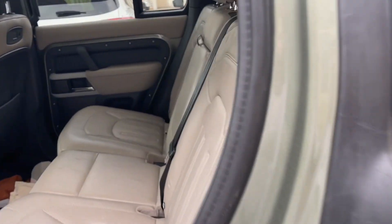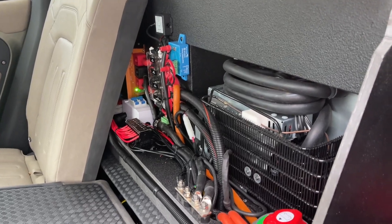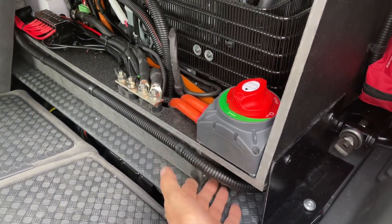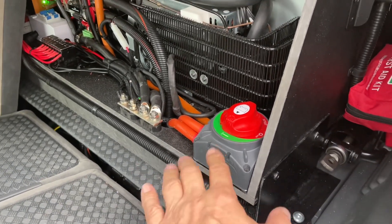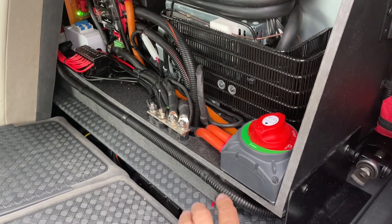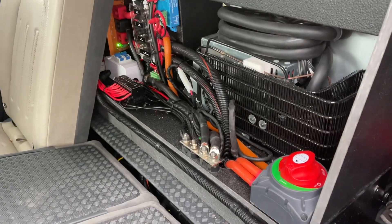Let's walk in and have a look at the back here to see how it all fits in. That's in there — that's as tight as the proverbial. That's our negative bus down here, large inverter, but we had to build up a packer underneath here. There's a 3000-watt inverter and 250 amp-hours of Clark Kent high-powered batteries underneath the boards in the bottom of the Land Rover.